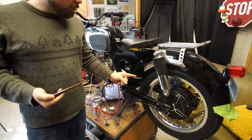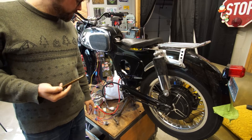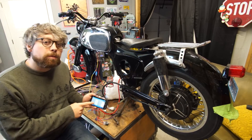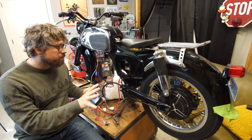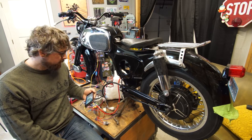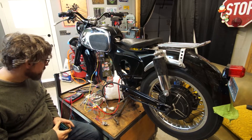I'm going to attempt to start the identification angle function. If the motor doesn't start to wiggle and make some noise, I'm going to be worried. I have the motor parameters written to the controller. I'll begin the angle identification function, which should start the motor moving around and making a little noise. I've set the identification angle parameter to 170, which is what the instructions said to do, and saved it. It's off right now, and when I turn it back on it's supposed to start moving around.